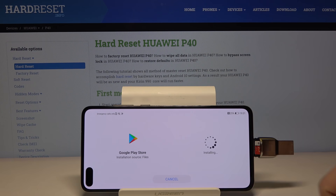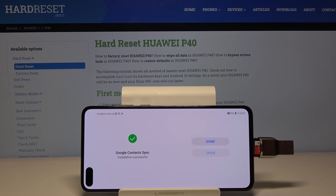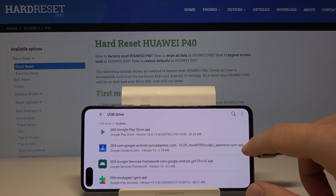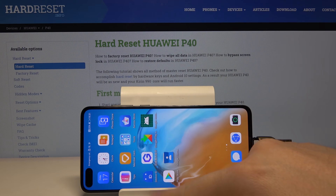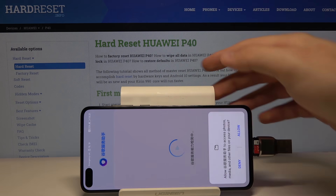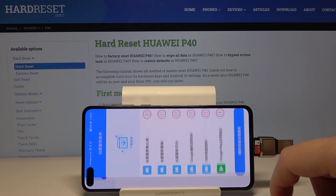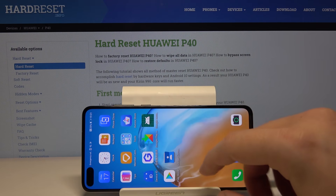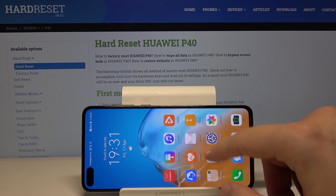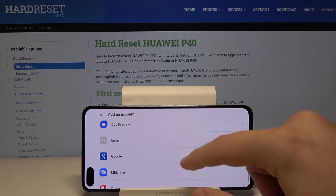Install the Account Manager, Google Play Store, and Google Contacts. Now go back to the main Settings, click and hold on the big G icon, tap Activate, follow the prompts and tap the buttons. Then turn it off, enter Settings, tap on Users and Accounts, Add an Account, and select Google.